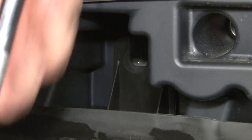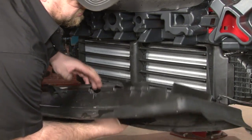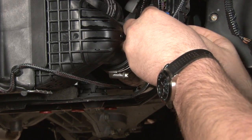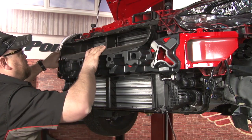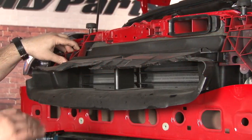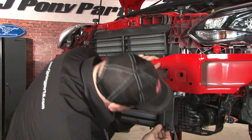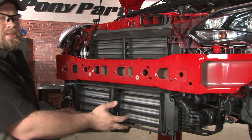Just like the rest of the front of your Focus, the shroud is held on by T30 Torx screws. We can slide it off the lower clips. Now the shroud's out of the way, you can see the flapper system itself. Before we remove the flapper, we're going to start by disconnecting the plug located right over here on the side of the radiator support. To make it easier to remove, we're going to unclip our bumper support. The upper grille inlet will come off — there's a clip on each side, just pop them free. The flappers are just slid into place with no hardware. Start with one corner, get it up high enough to get it free, and do the same thing on the other side. Once you have it free, let it rest on the factory intercooler.